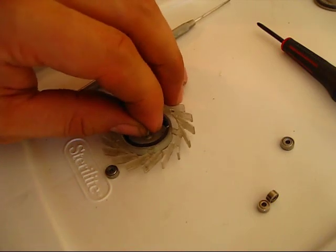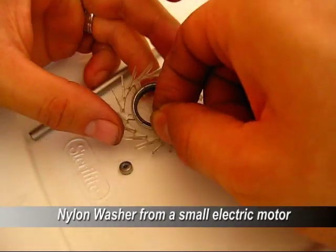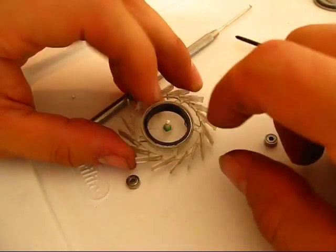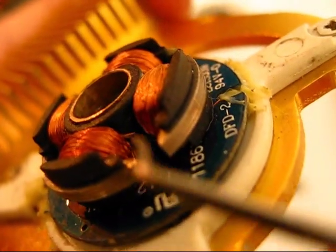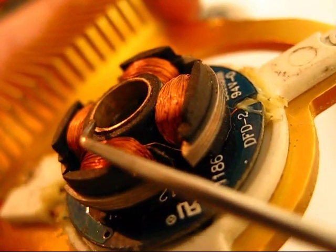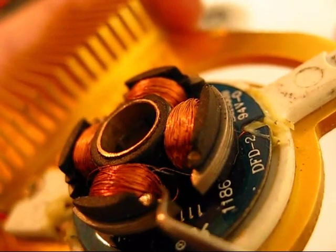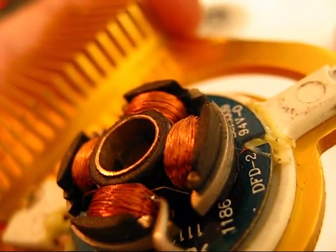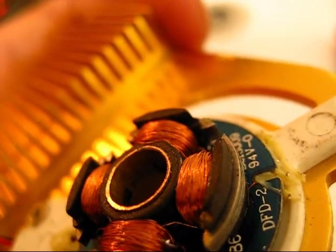I needed a little small washer in there too. Yet another thing I had to fix: while trying to knock down the top of this bushing by filing it, I broke one of the windings in the motor. So I got in there and dug out the two ends, brought out a loop, soldered them together, and now I'm going to glue that down with Loctite. I just tested it and it works — so another disaster averted.